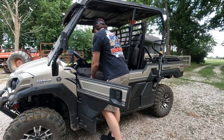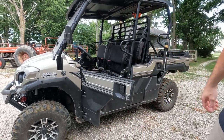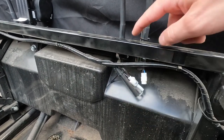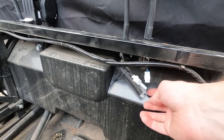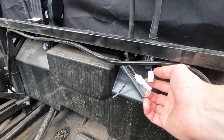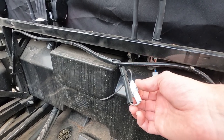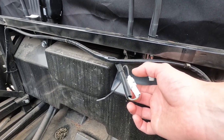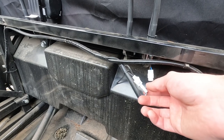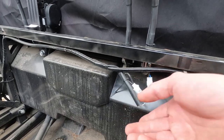All you have to do is lift this seat up and get it out of the way. You've got this wire right here which runs up to your seat belt, and then this is your new bypass piece. This normally attaches here, so you just unplug that. It has a little loop part that tricks the UTV into thinking the seat belt is plugged in all the time. You just unplug that and plug this in — super easy.